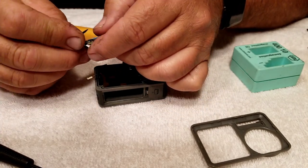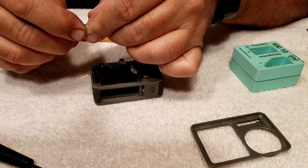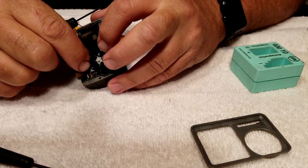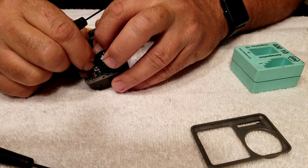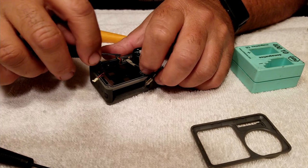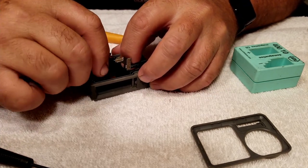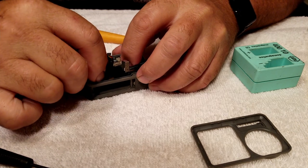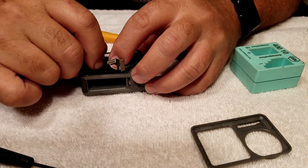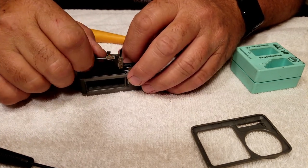Here's that last little bit of glue that was holding the wireless antenna, and I want to go ahead and get it off. Right here I'm going to separate these connectors by releasing the tape that's holding them all together — it makes everything come apart a lot easier.